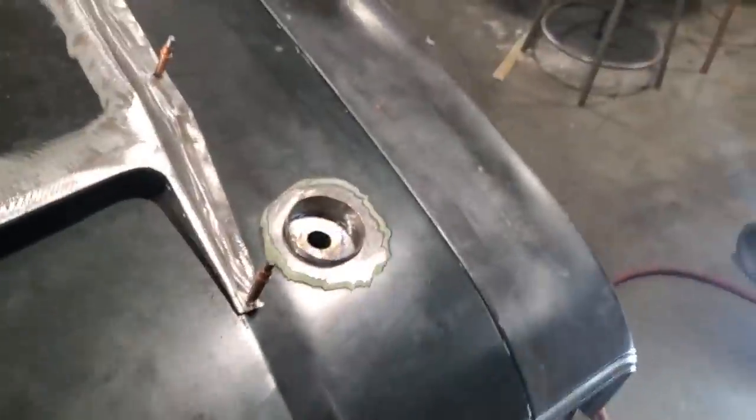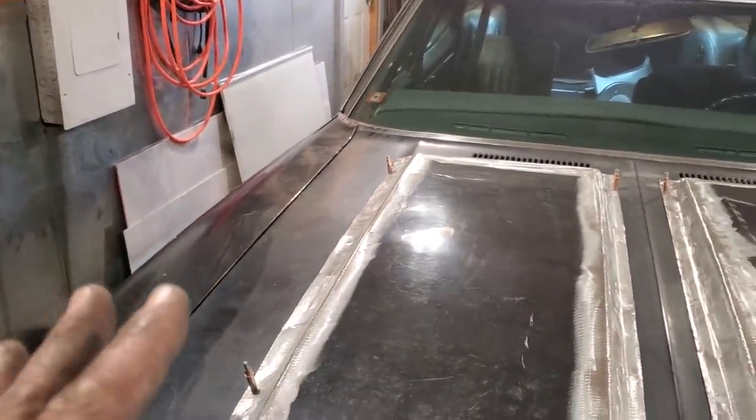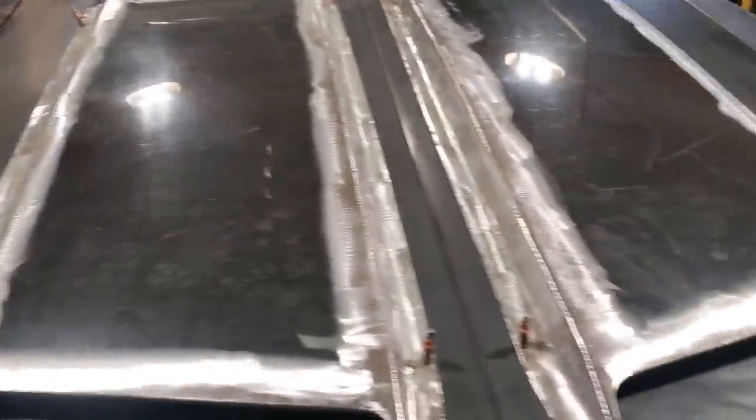And then once you've got the panel aligned, what I'll do is reinstall this now. See, look, this hood closes now. It's got a nice seam there. It's lined up with the molding here, and it's lined up with the molding here, right? So everything is lining up for me, and I'm happy with it. And so now I can put the latch on, and I know that this is the gap that I want. So when I put my latch on and it pulls one way, I know it's the latch and not the gaps on the hood.